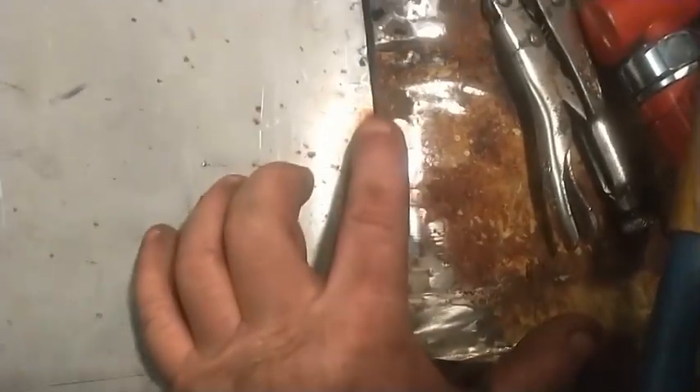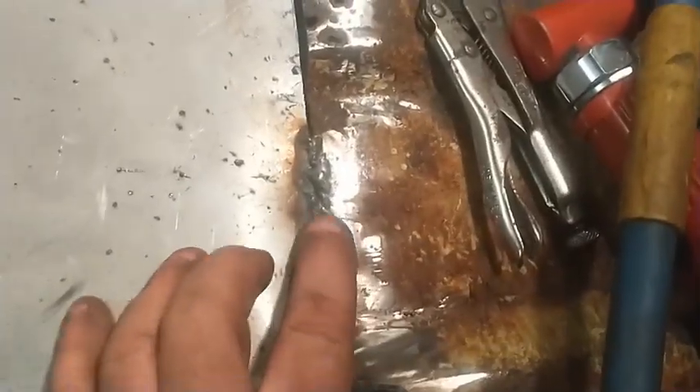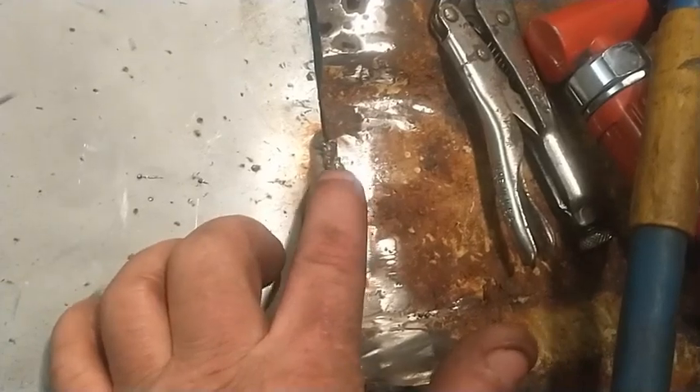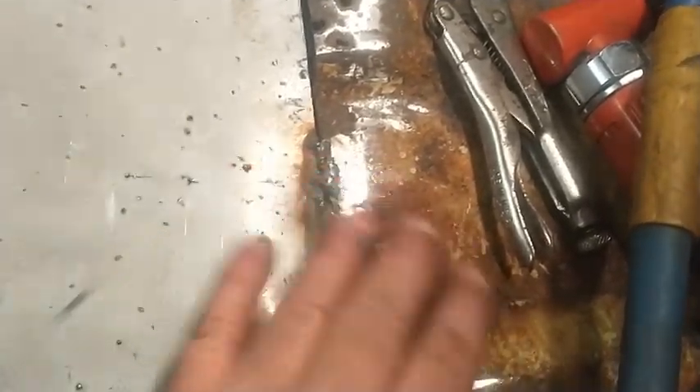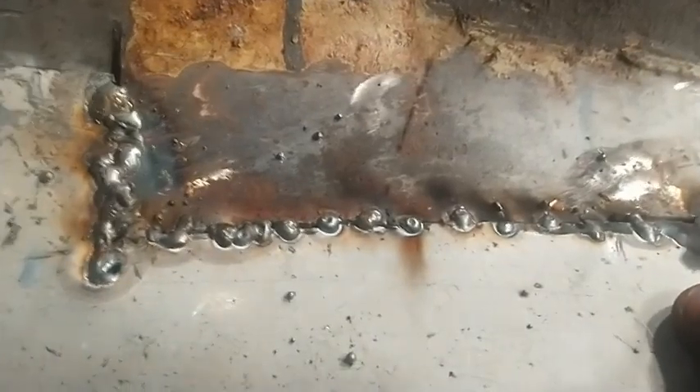This is all stays up to here, and then when this back piece gets put in it'll meet up here. So these are just a series of little tacks — tack tack tack tack — no real continuous welds because you can't do it that way. Spot spot spot spot. I started out doing tacks every inch or two. You have to adjust the metal so it's even — I use the body hammer, put a screwdriver in there, lift it up and down. Then just tack tack tack, and I came back, flushed them off, and I'm going in between those.